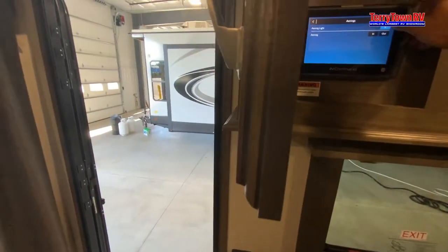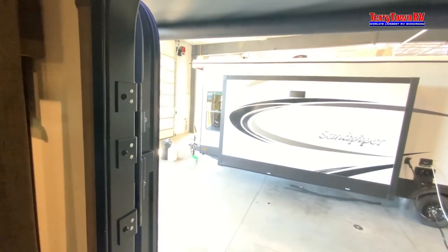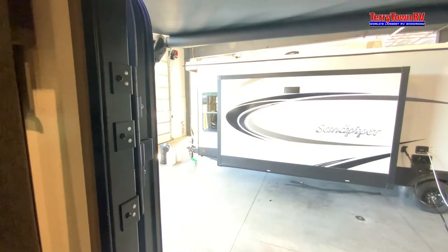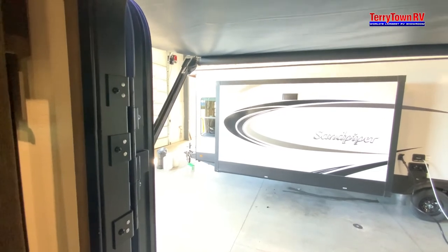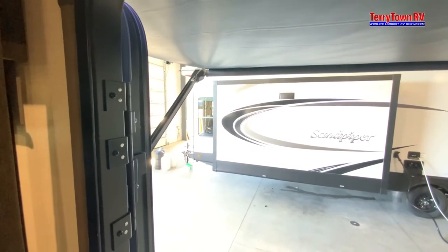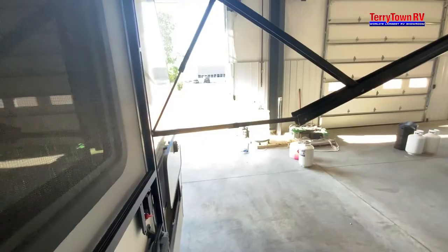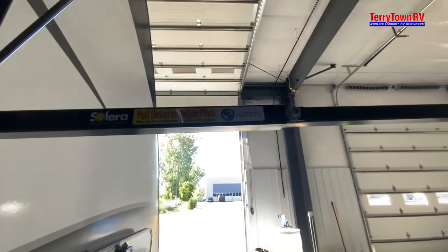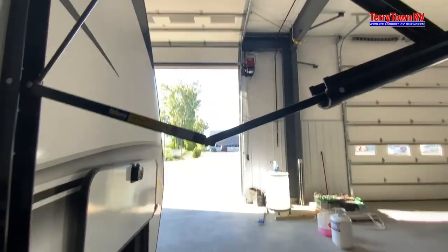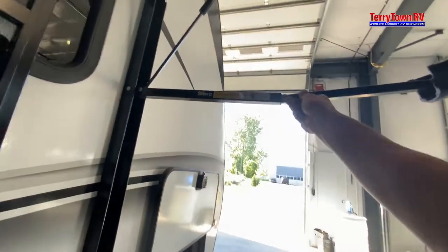Awnings. Awning light for outside. If you hold the awning button for too long, the awning will reel in the opposite way, so once you see the tube of the awning you're fully out. To pitch it for the rain, you can either choose this side or that side — it doesn't matter whichever way you want the rain to fall. Go to this elbow and pull down to create this bend; now the rain would be falling this way. They say you can run it in bent, but I push it straight a little bit before I run it back in.